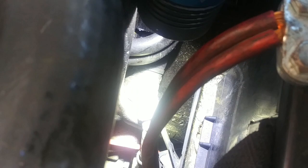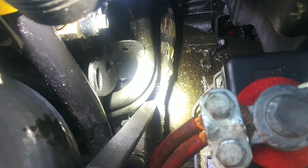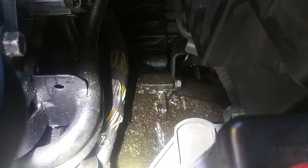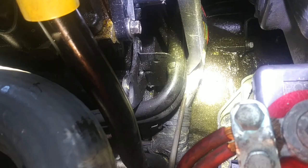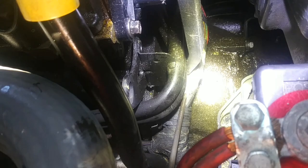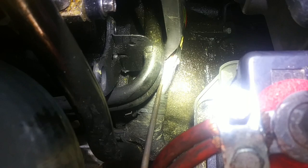That's not too bad, but the one that really caught me — if you can see right here — the wire harness is rubbing against the sharp edge on this bracket. So I took my pry bar and moved the wire harness away from that sharp edge. You can actually see where the wire harness has been damaged by this edge of the bracket, down to the point where I can see a little bit of the wire, one of the wires, exposed there. I've got the edge of my screwdriver pointing right to where the wire has gotten down to where the copper part is exposed — that's where it was rubbing against the bracket, shorting out.